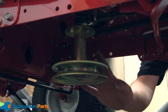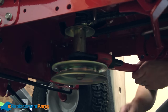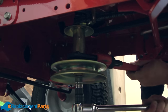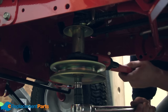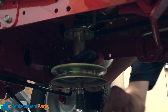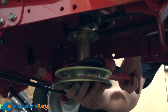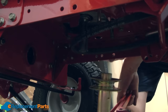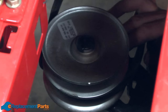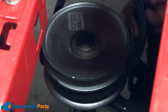Now I can remove the belt between the motor and the rear of the mower. To do that, I need to remove the pulley. We'll use a pipe wrench around the spindle on the pulley and then a ratchet wrench from beneath to remove the bolt. Now we need to pull the belt away from the variable speed pulley — the center section of the pulley is movable. By moving that center section up, I can pull the belt away from the keepers on either side.